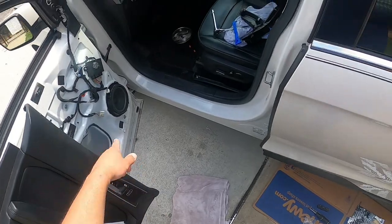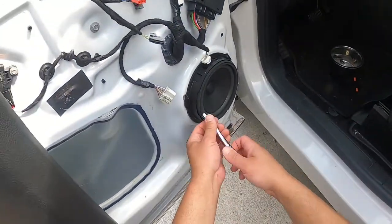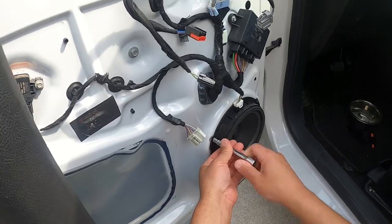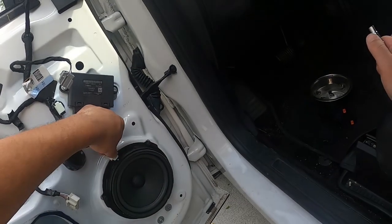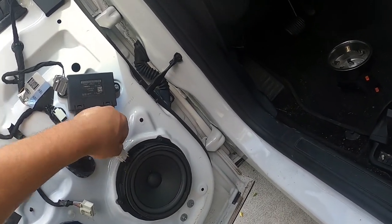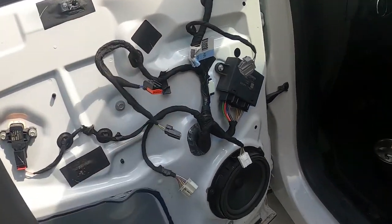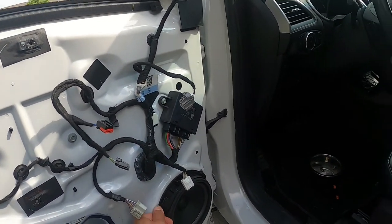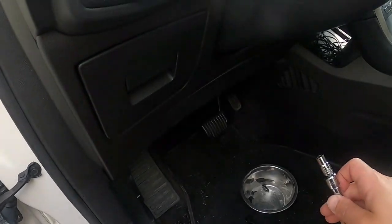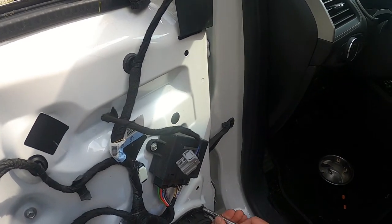So these are 7mm bolts, and these should be finger tight. Oh, tip, get something to kneel on. Just take your knees. So we're going to take this off. Oh, first take the clip out of here. Oh, tip, make sure your windows are down. Wind down your windows when you do this. So we're going to undo screws, and I'll keep these screws separate because they almost look like the ones that were from the bottom. Probably the same kind, but I keep them separate.